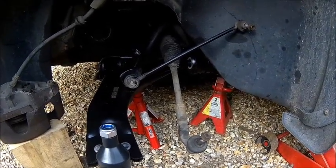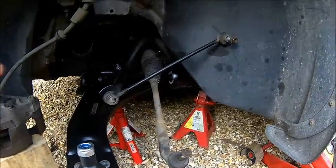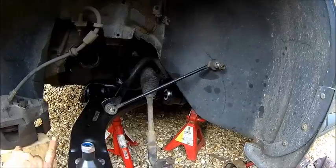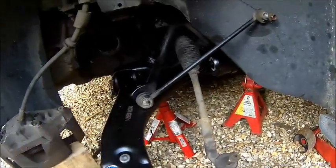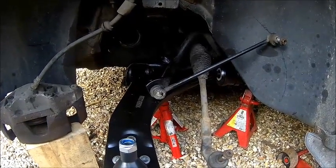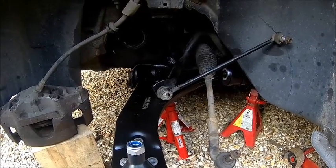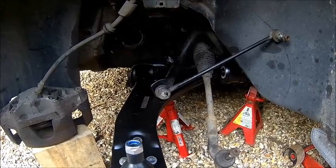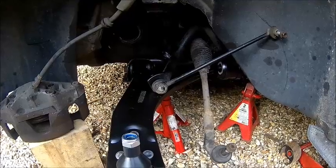We finally got it in. You need to set the rear ones first and then the front one — there's no way otherwise, the alignment of the bolt is just miles out. I had to push it quite hard and lift it. It depends on how these rubber bushings are sitting in this thing. There is a possibility that something is bent here — not much, maybe a few millimeters. The other one was far easier; this one was just a bit tough to get in. The thing is, it's only located by the bolts and there's a little bit of play.